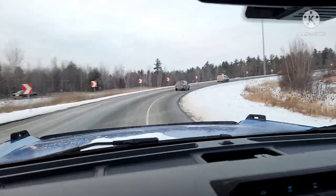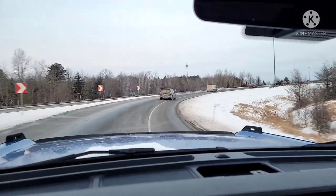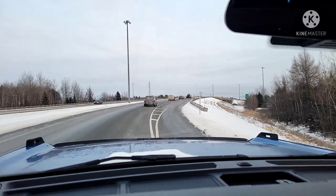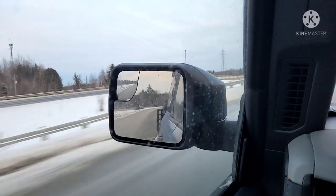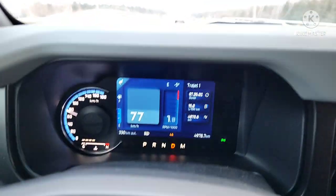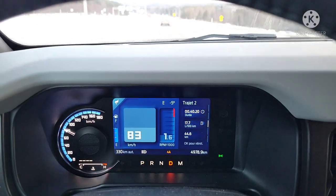Normally, the weight transfer — even when empty and driving quick — pulls to the opposite side, and the trailer would also increase that weight transfer. But there's next to no weight transfer because the Ford Bronco has torque vectoring: when needed, your front inner wheel will brake slightly to keep the vehicle's weight balanced pretty evenly on all four wheels. That is some amazing tech.